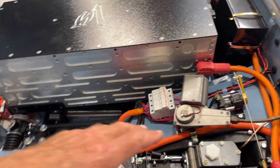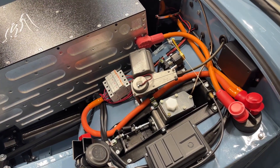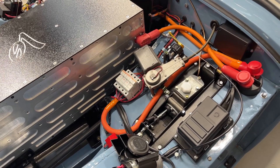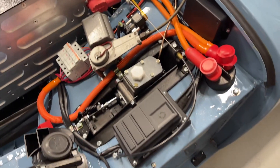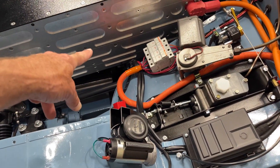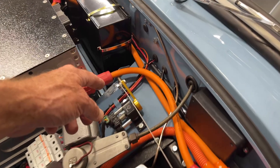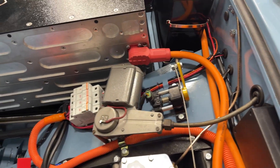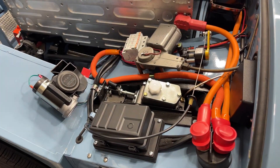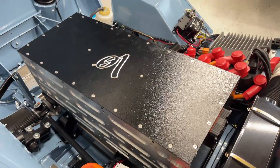We have a wonderful contrast here between this high-tech universe and a very low-tech wiper motor — a central wiper motor used in MG TDs and Jaguars from that era, very low-tech, one speed. One thing I really like that Terry built: we use a cable-driven throttle — the same throttle cable that would go to the SU carbs — running it over to a boss on the master cylinder tray, then driving the cable to a potentiometer. That potentiometer tells the computer how much juice to apply to the rear wheels through the batteries — old-fashioned cable speaking to modern technology.